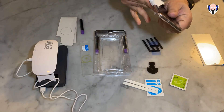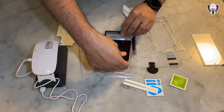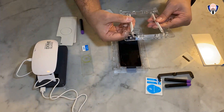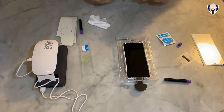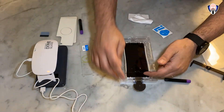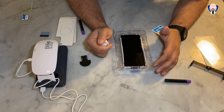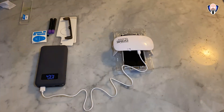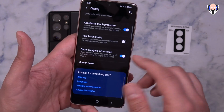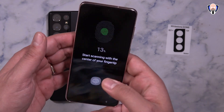When it comes to the Galaxy S21, the installation is a little bit different — we don't have any mechanism system like on the S21 Ultra. Everything works the same way we've done it in the past: you insert your device, clean the display, and make sure you're in a level, dust-free environment for the best installation. Once done, do the same process — 15 seconds on the top, middle, and bottom for initial curing, then a full 60 seconds top, middle, bottom. Then turn on the high sensitivity touch option in settings, re-register your fingerprints, and everything will work the exact same way.